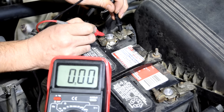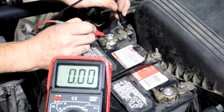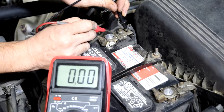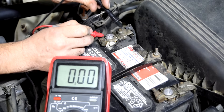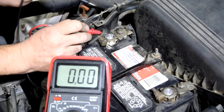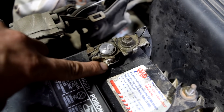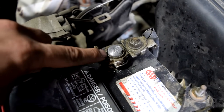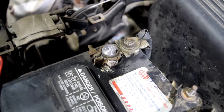As you can see we lose nothing when we go from our battery terminal to our battery terminal connector, which is a good sign and means there is no excessive corrosion around this post. But look what happens when I put this test lead on the area where we do have some corrosion — we lose about 1.35 volts. Now this corrosion is only on one little area here, but if it was excessive and all over then we would be having problems starting our vehicle. It is something that needs to be addressed before it gets excessive.